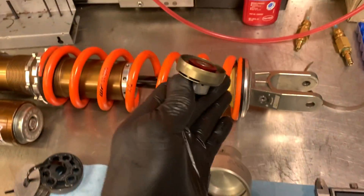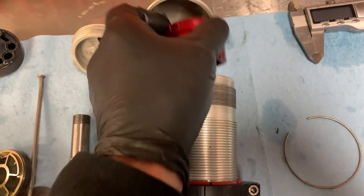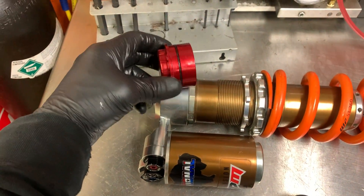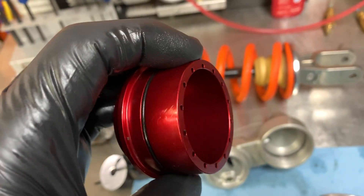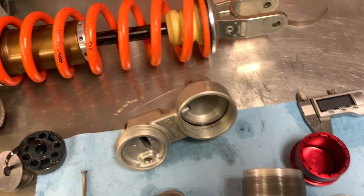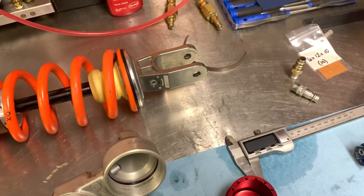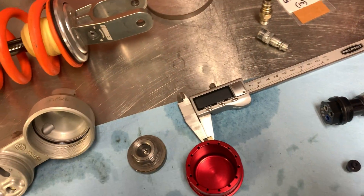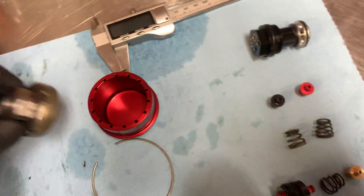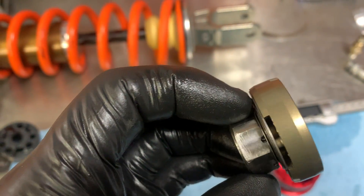As your shock compresses deep into the stroke, this cup — the huck part of the huck valve system — sits inside the shock body at the very top of the shock. As you get into that last bit of travel, which translates to roughly the last four to six inches of wheel travel, this piston drops into that bore and dramatically increases the amount of compression damping or resistance to compression. That's what a huck valve does — it's hydraulically controlled bottoming resistance using a piston and shim stack. And that's in every National Shock.